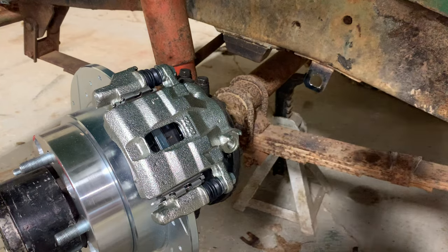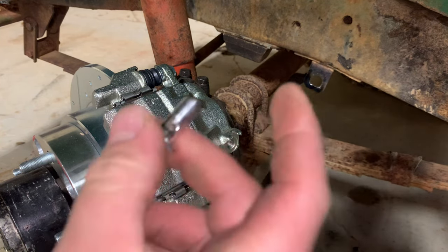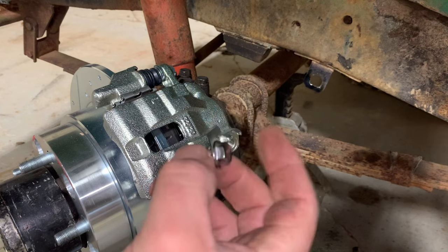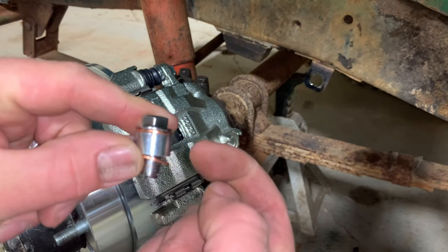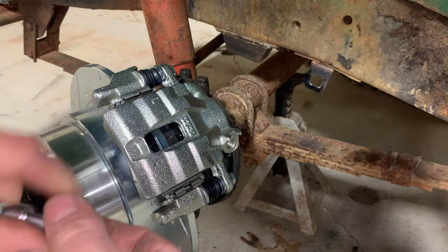Something to keep in mind, and I'll have these linked down in the description with all the other parts. The last time I did this, the calipers I ordered came with the banjo bolts. These are M10 by 1 banjo bolts, so that's just something to keep in mind. The way this goes together, you're going to have the banjo bolt, copper washer, the hose, and then another copper washer.